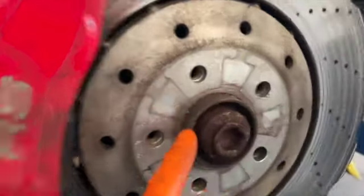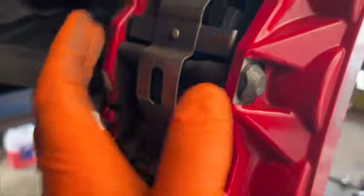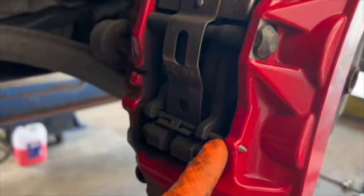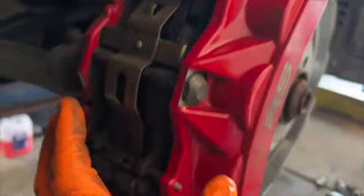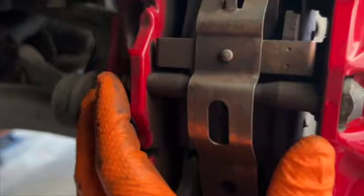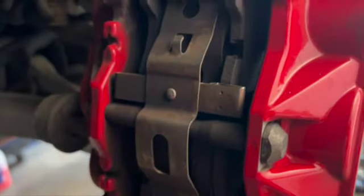Firstly, these do have a tendency to seize. Someone's put some copper slip on this but we're going to clean all that up. You've got pin number one, pin number two — you would definitely want to apply some lube but that's how they fit. You've got to push this back, push that back, out, and there is — I think that's a 13 but probably an 11 or 12, I'll find out in a minute. We've got to undo that and that's how we're going to get these back.